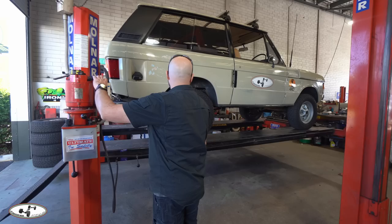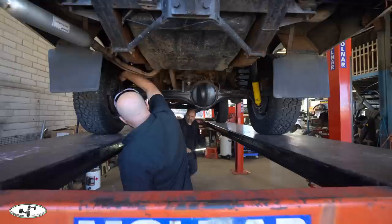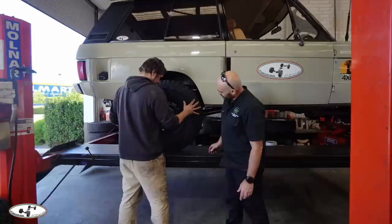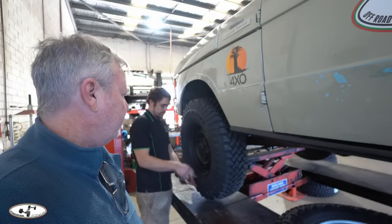The question is whether they'll be able to do a wheel alignment with this much sag on one side. We confirmed that all the part numbers correlated correctly and there appeared to be no difference between left and right springs. But a call to Paul Marsh in South Africa — he explained they're not all the same and suggested we swap them over, and that almost completely solved our problem. I like the look of the matte black.